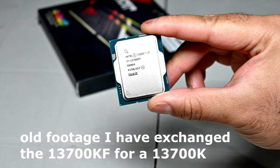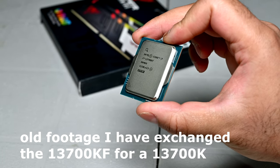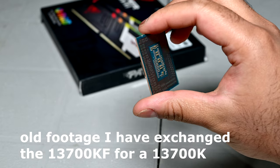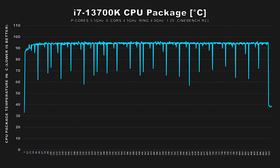However, up until recently I decided to upgrade my test bench to Intel's Core i7 13700K so that when I do GPU testing, I'm not holding back any performance. While the 13700K is a blazing fast processor, boy oh boy does it run hot. When running an all-core workload like Cinebench R23, the processor instantly jumps to around 90 to 95 degrees Celsius and I will even see the temperature warning sensors engage, informing me that the CPU was thermal throttling at one point.